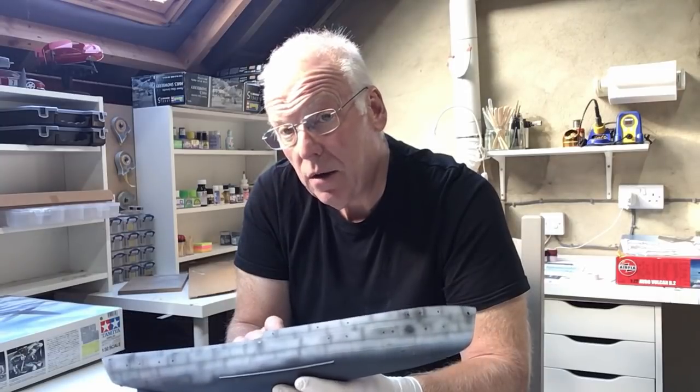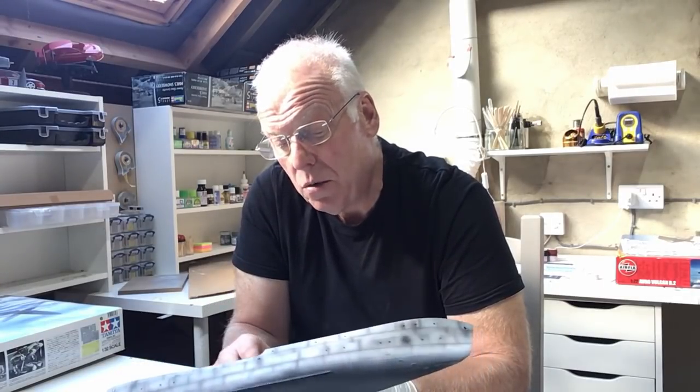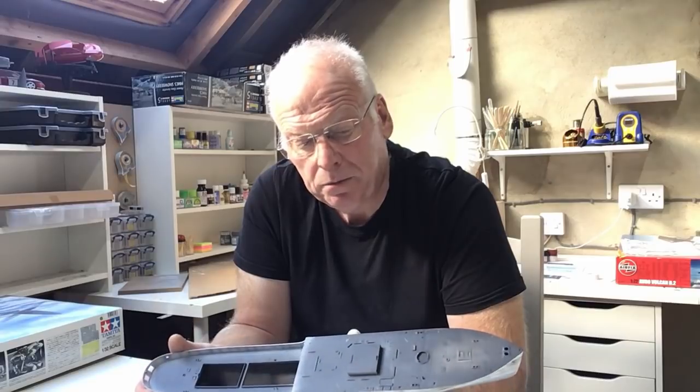And it turned out that when I dismantled it, it appears that the condensers failed on the electrical circuit, so that's needed, I think, to give the motor enough power to start it up and overcome the inertia of the motor. And because the condenser had failed, I was just getting a buzzing noise, so there was power getting through, but not enough to start the motor running. So I am actually going to get a replacement condenser and try and fit it and see if that makes the difference, see if I'm right.